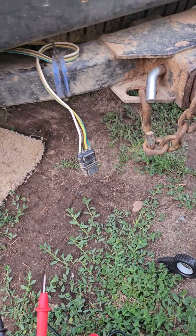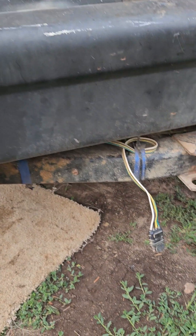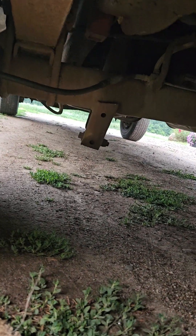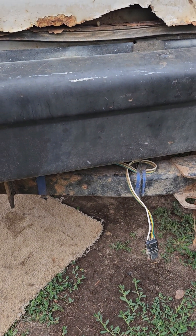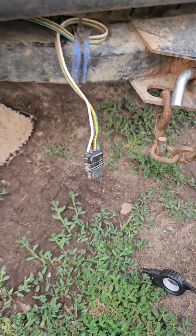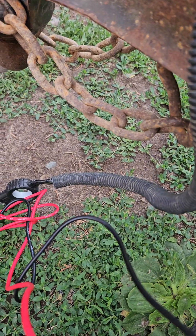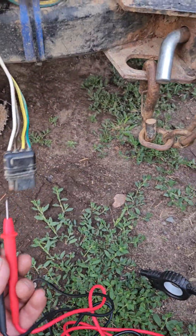This is how the 2008 E150 has wires coming back underneath the van. Just Google '2008 E150 trailer wires' for the van. If you check them with a meter, there should be a ground on this one and that one.